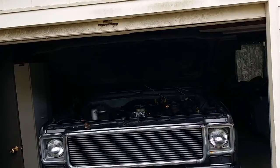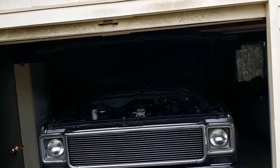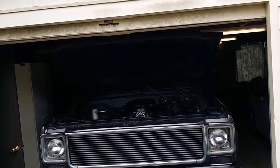Okay, I didn't really want it to come to this, but I'm going to do it. I'm going to set the motor cranking. I'm going to come around and tap it with a hammer underneath just to see whether or not that fixes the problem. Okay, so this is a test to see if the starter motor's sticking on the flywheel. Okay, well, here goes nothing.